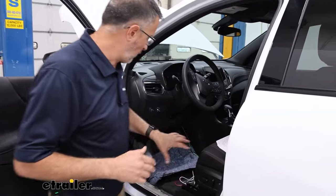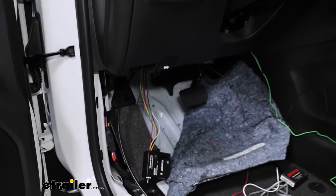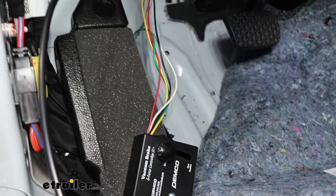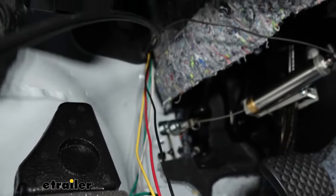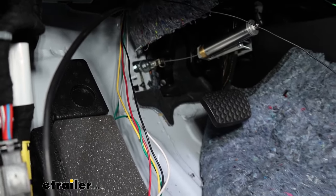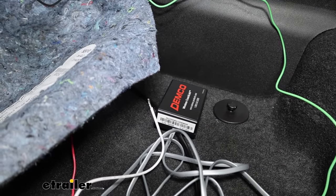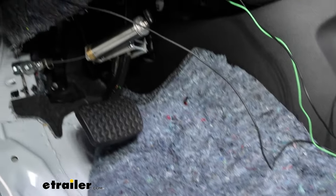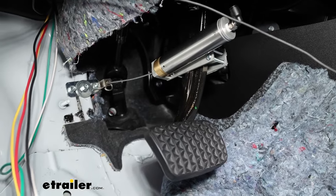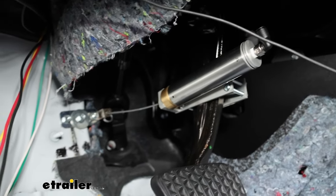The other components of the supplemental braking system install in the driver's footwell. First is the g-force controller — those wires are fed through a grommet in the firewall and lead outside to the main operating unit mounted on top of the fuse panel. Also included in this kit is the wireless coach link, which feeds signals up to your RV and lets you know when the brakes are applied. The last component is the brake cylinder that attaches to your brake pedal arm and physically applies your brakes by pushing or pulling the pedal in, followed by a cable that attaches to the firewall.